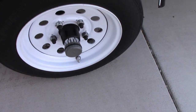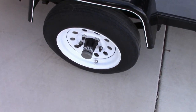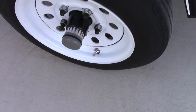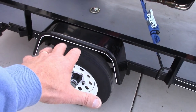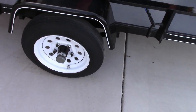You want to add bearing buddies — these are the ones that have a weep hole in them. They're just turned to the bottom so when you pump it up you don't blow the seal out; it'll come out like a little worm. I always put a little nylon tie on the cap so they don't fly off. You run those things at around 45 to 48 pounds of air. It's got a normal 5-lug, which is good.